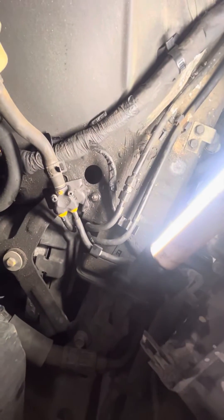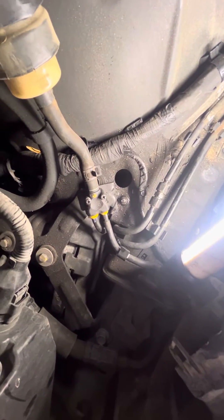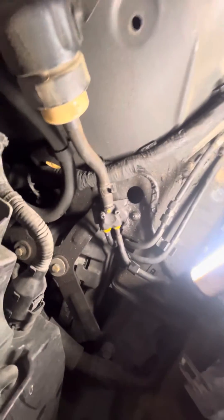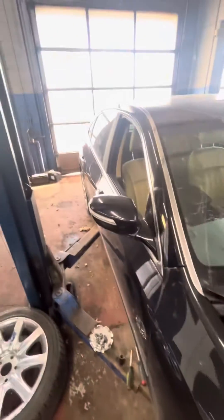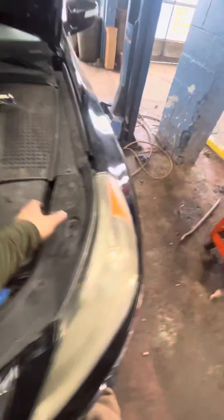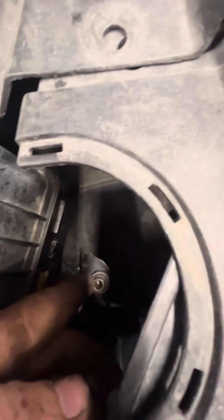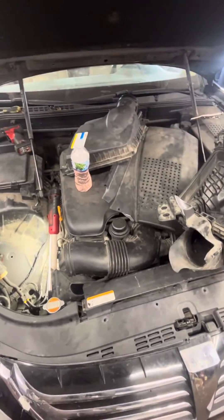What happens to this car is if you have a leak and the air pressure in the system drops below 64 psi, the air compressor stops kicking on. Not only will you have one airbag down over time, all of them are going to go down and you're going to think it's a compressor issue because you don't have enough pressure in the system for the compressor to engage. The compressor can only fill up your system if there's at least 64 psi pressure. To get to 64 psi, you need a scan tool and you go through the functional tests, then use a regular blow gun to blow air in there. You need at least 64 psi for the compressor to kick on and bring the airbags up.